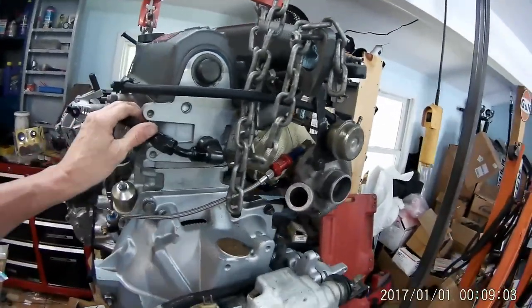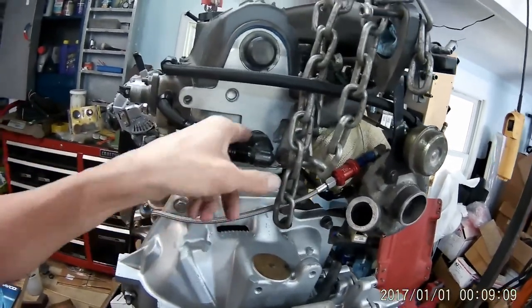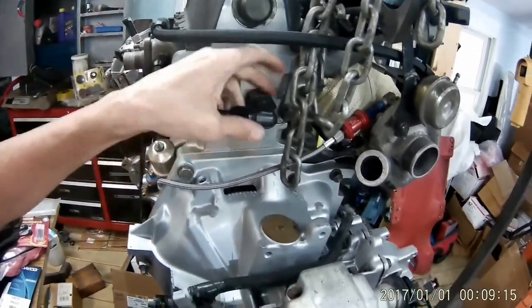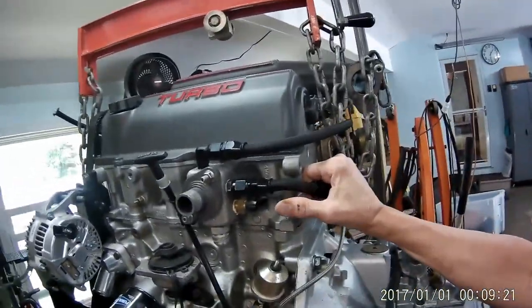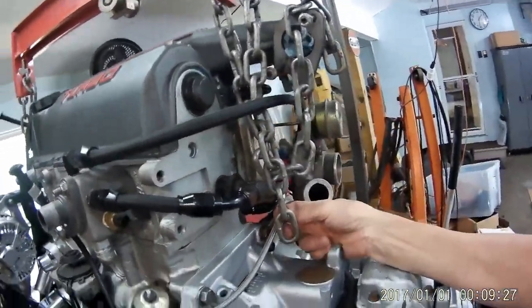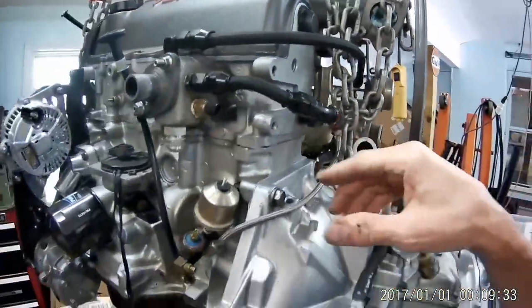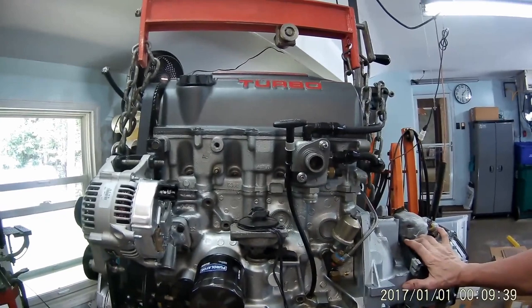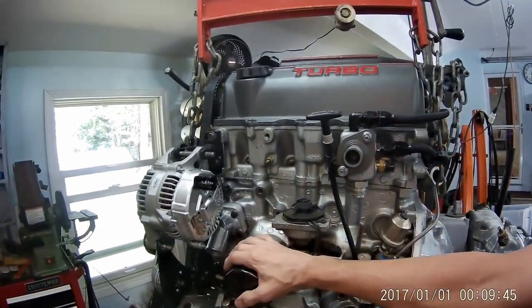My 4th cylinder coolant mod — most people bolt the plate on going through the side wall and run a hose over, but I've tapped it for 1-inch MPT and dropped it down. This works well; I've tried this before. The coolant hose goes over to the turbo, with the braided oil line going through a filter into the turbo. The engine itself is a 2.2, 40 over, with plus-40 injectors, a Stage 2 turbo setup — I guess it's a Super 60 setup.